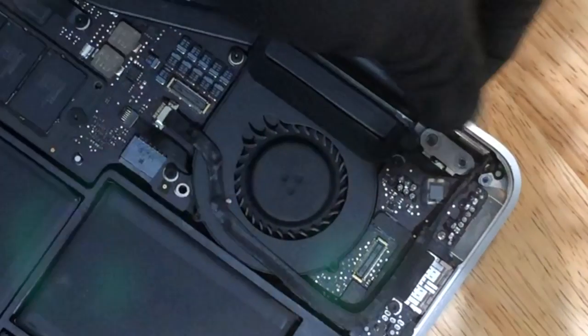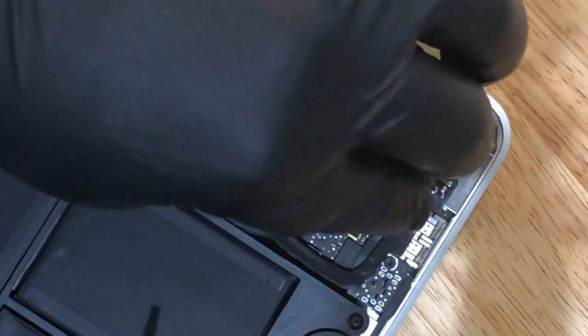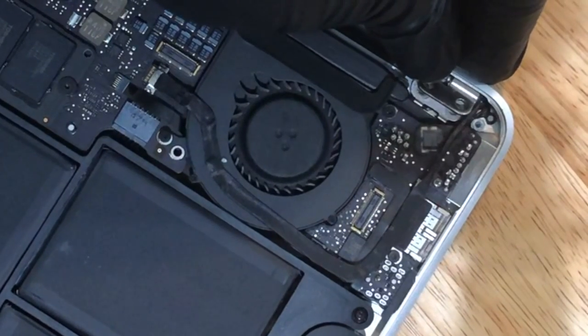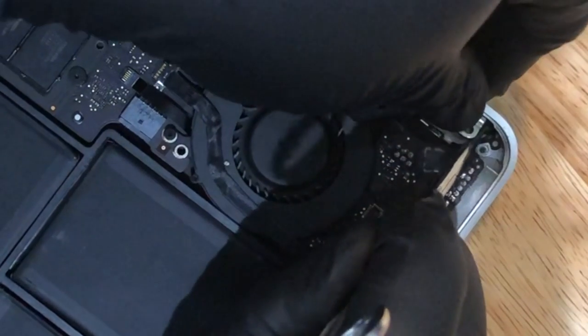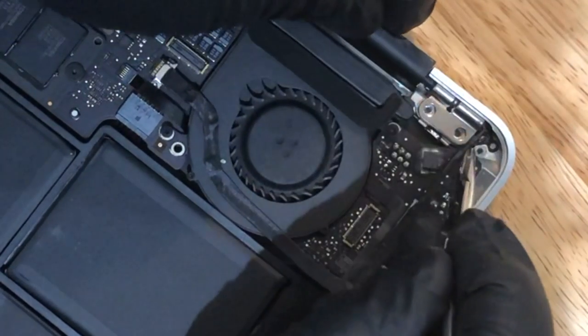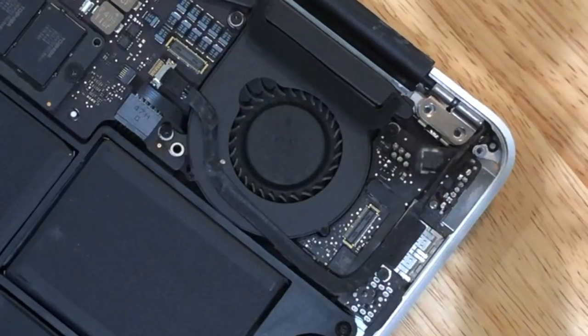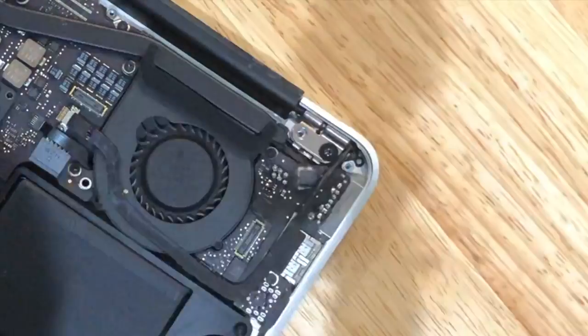Push the hinge down and don't forget to gently reconnect the iSight wire snap — there's a little snap that you want to press the iSight cable into. Now push the hinge back down by hand and align those screw holes so you can put the hinge screws back in. Make sure you don't clamp that wire — notice I moved the wire from up underneath the hinge. Now reattach the remaining two base hinge screws.